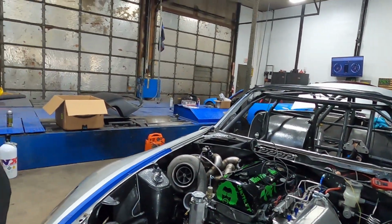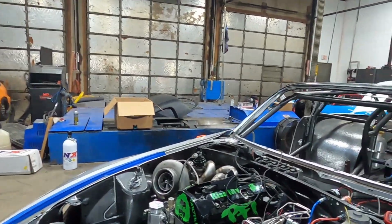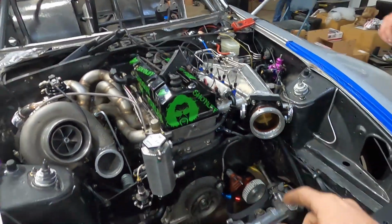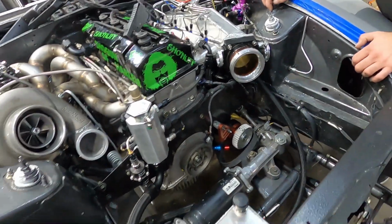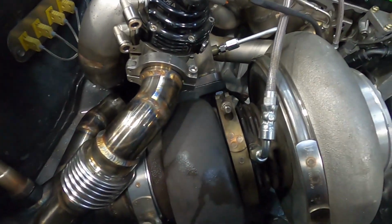Yeah, that's it for sure. Four cylinders running. It was a race to get it to start. We got her to start. Now I need to go through things. I've got to fix this throttle body. I know what to do with that. The fuel pump, I've got it set up for reverse rotation at the moment, so I need to flip that back around, and then I need to find out what's going on with my turbocharger and the oil.